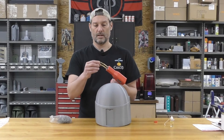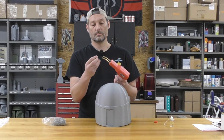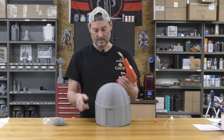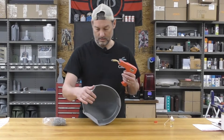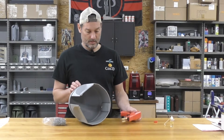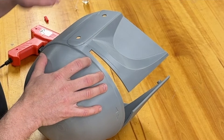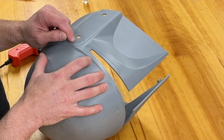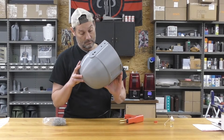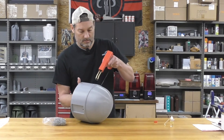So this is a plastic welder. The way this works is it comes with all of these metal pieces that you simply stick into the end of the gun. You press the button, it heats up the tip, and then you press it into the plastic. It's usually used for automotive stuff, and I'll drop a link in the description where you can get one. I've decided I want one right here on the outer face because that's where the crack starts, and I'll slip one in right here where the ear cap will end up covering it anyway. Back here I'm actually going to go on the interior. So we're just going to use three of these — we don't need to overdo it.